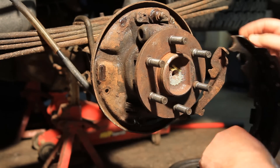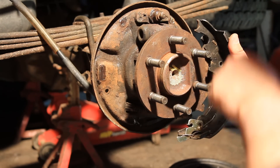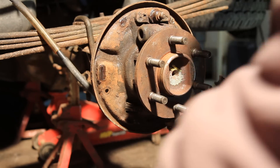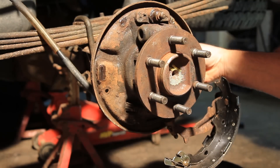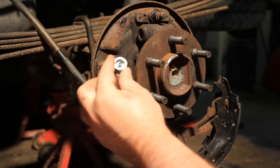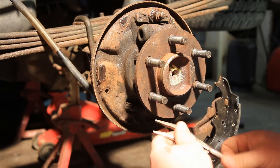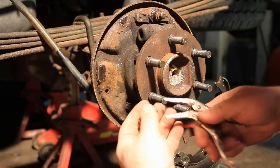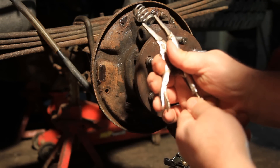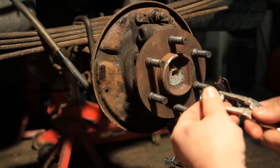So the first thing you want to do is get the parking brake lever and put it into the little hole here, like that. Now we need a pin that goes through the back like that, and a retainer here and spring to put these back together. This tool — I can't seem to work it — so I just use vise grips and grab onto this like that.